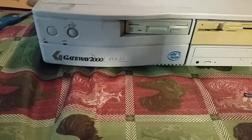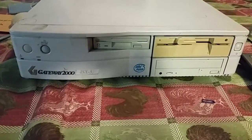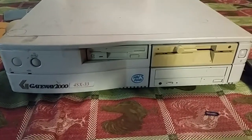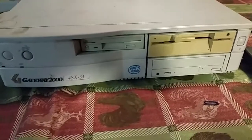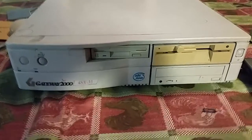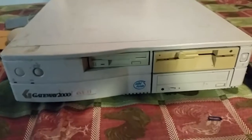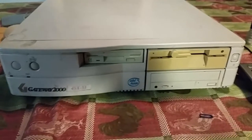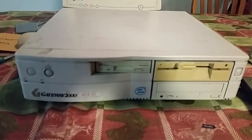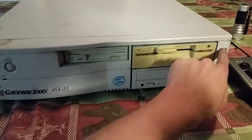Here's what transpired. Apparently E-ISA is not backwards compatible with ISA, and this only has ISA ports. Also, this isn't the exact system — it's similar. It's not 66 MHz, and it's not the exact model, so it doesn't have EISA ports. And all of the ISA cards I have that are video are being taken up, so I'm using the onboard video, which seems to be okay for what I'm going to use it for. But let's show what I've been able to complete.